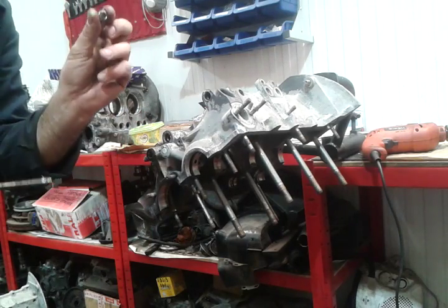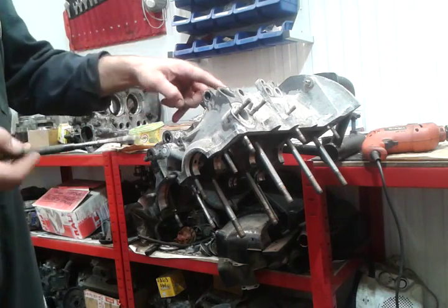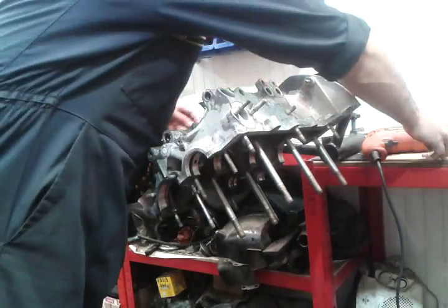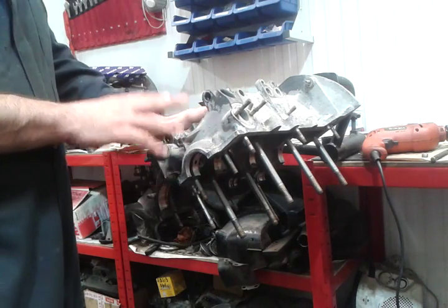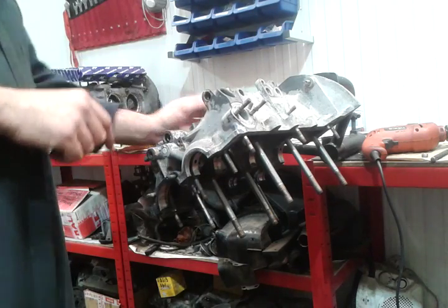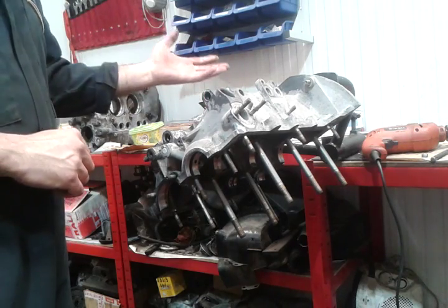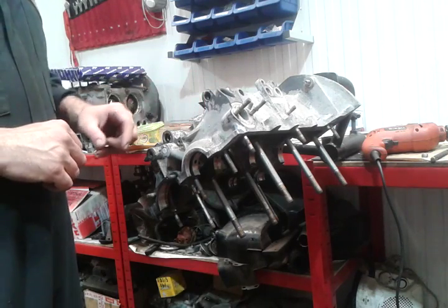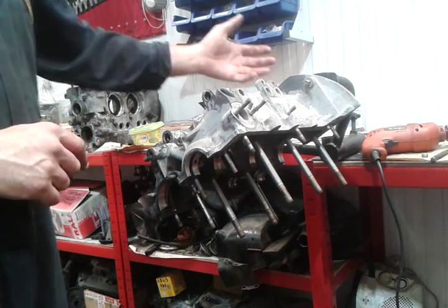There we go, that's how we do it. In the next video I'm going to show you guys how to tap these galleries and how to use the plugs. The plugs are really good because you can always remove them to clean and inspect your gallery. I do it in all the engines that I sell or rebuild for my customers - I normally drill and tap all of these out. The one I don't normally do is this side one - not very necessary because you can clearly see when the gallery is actually clean or not. I also do a big one in the back but I'm not going to show you that because I'd have to strip this down and the video would take too long.